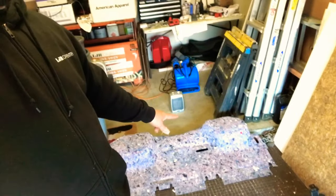Should it be a recall? I think it should. I want to say thanks to everybody on the forums — I went on the Ram forums and asked the question about the water coming in, and about 98% of the 40 to 50 answers I got said it's the third brake light. But I like to make sure, so I checked the window and the cab vents too. It was the third brake light — thank you to everyone who helped. The back panel is staying off until I put it all together. I did a 50-50 bleach and water spray to get rid of that dirty sock smell. Heat is on, blower is on — I'll keep that going for a couple nights and check it tomorrow. If it's dry, I'll put it all back together.